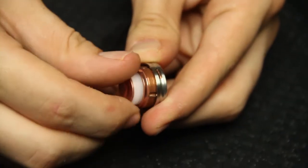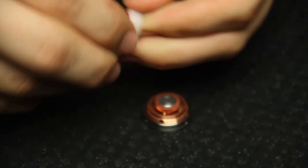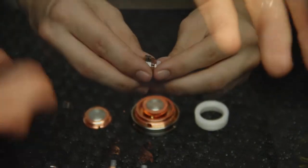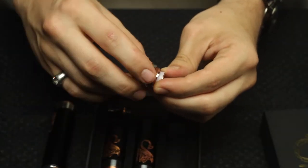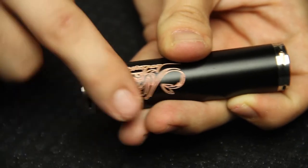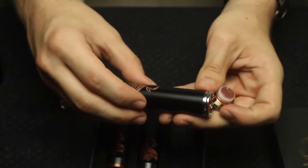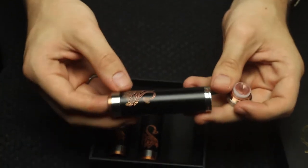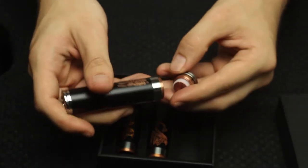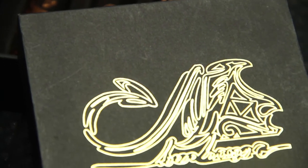Now let's move into the cons. This button — the plastic piece here — it's kind of loose. It doesn't take much to turn it. So when you screw it in with a battery in it, you kind of crank down that connection and the button will lock up, and this mod will just fire on its own. For an inexperienced vaper who might not know that, they could put it in their pocket thinking it's locked and all of a sudden it starts going off, which has happened to me. That's a big con for this device.